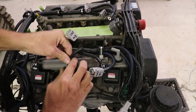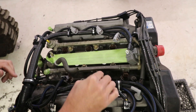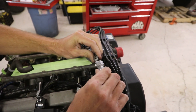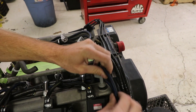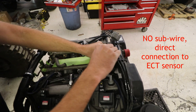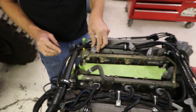Connectors have some abbreviated labels on them, so obviously we have our three ignition coils here. Along this line we're also going to find your injector — number five injector connector there. The other two are close by. You can take the knock sensor sub-harness coming up from the valley and connect it here. ORS deleted the small sub-harness that used to connect to the ECT sensor — engine coolant temp sensor — and just went directly there with the connector plug.